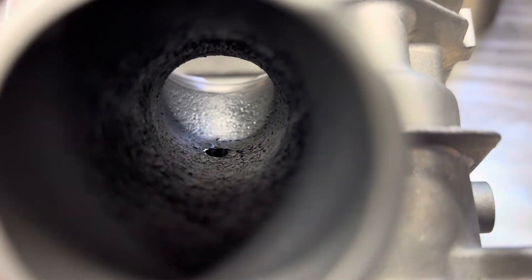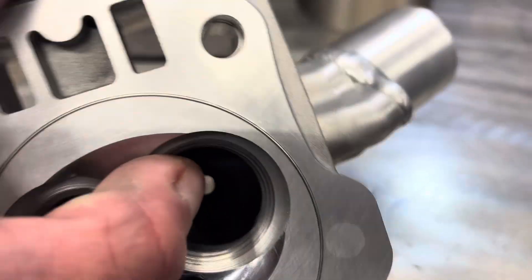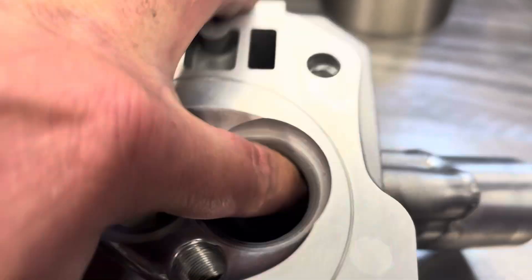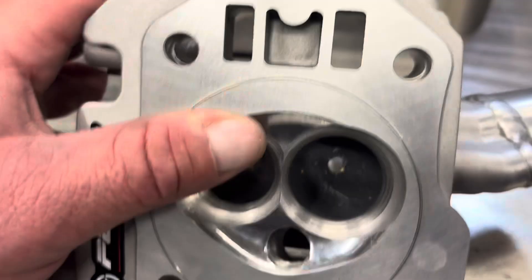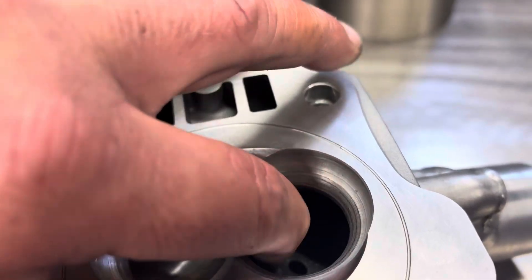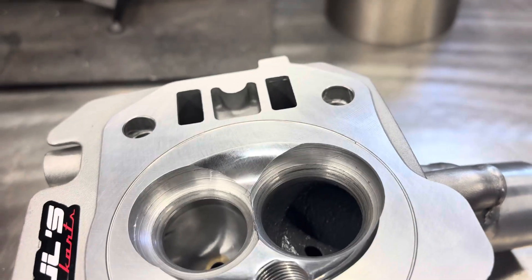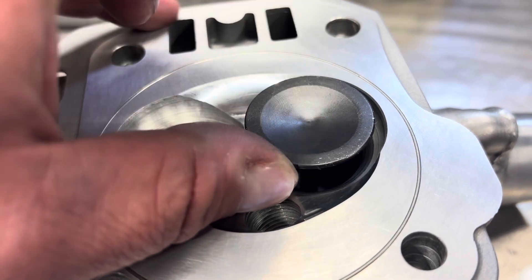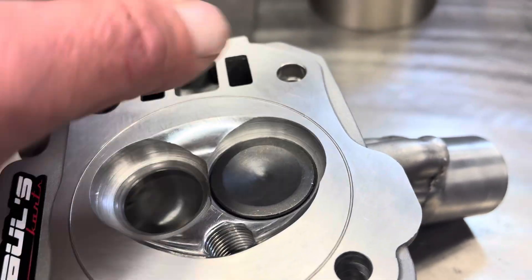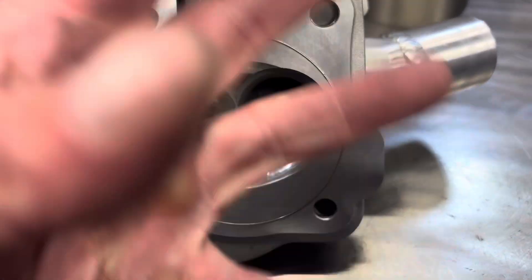This also has the epoxy port, so straight walls — huge. You definitely want to have straight walls. You want to have a radius in the back corner. You want to have bias porting — this wall is going to be way far to your left, almost under the seat, and then it comes up and swooshes in. This is also biased. What that bias does is create circular flow that helps distribute the air, because you're not just coming straight up — you have a valve sitting in the way. You need the air to start pushing itself sideways, coming this way, this way, this way, and this way. That bias starts in the port and creates the swirl that pushes the air out.